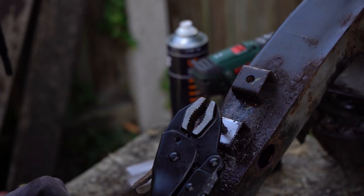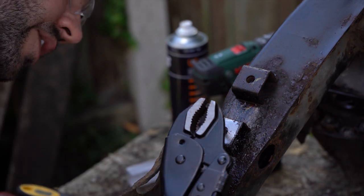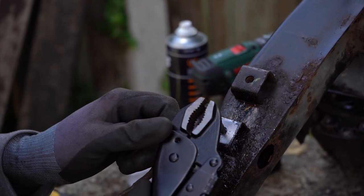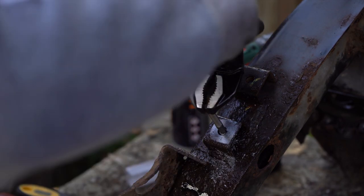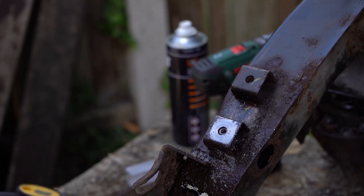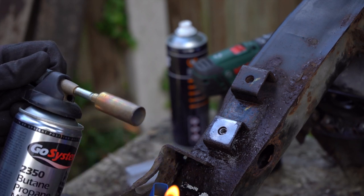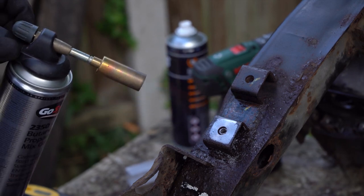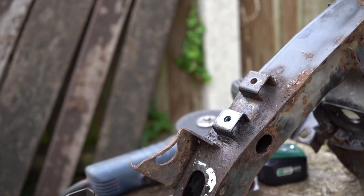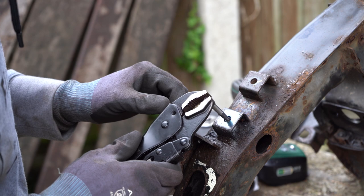That's not a good sound, I do not think. It's hard to tell whether that's the stud working its way free or the screw extractor snapping. I suspect it was the latter. No, the threads are still okay. Right. Heat it is. Right, so now that it's had time to cool down, I'm going to give the screw extractor another go.